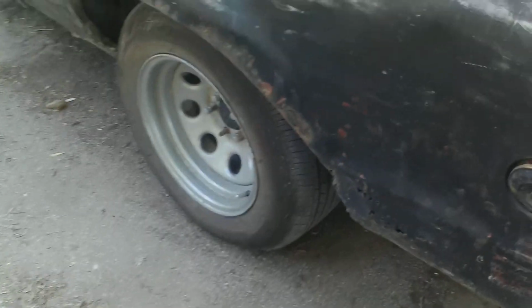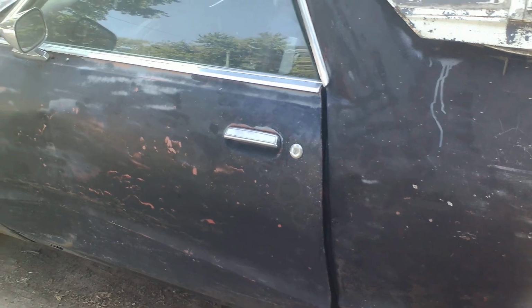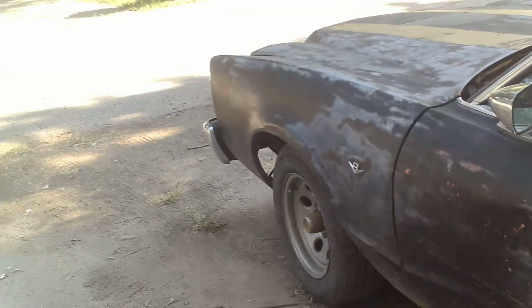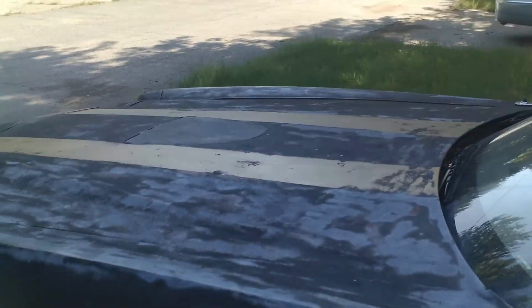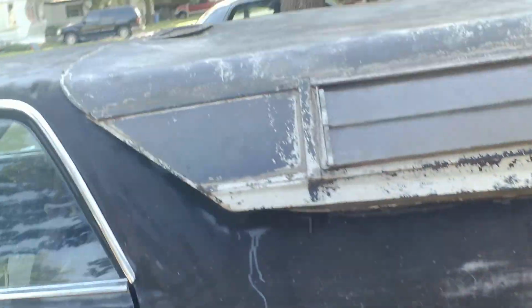It's an intact car. You can't smell it, obviously, it's a video, but my exhaust smells a lot cleaner and a lot less like raw gasoline, because I've tuned it up, and I actually learned how to tune a Holley 2-barrel H2 2300 carburetor for fuel and air. Basically, you tighten them all the way tight, then loosen it 1.5 turns on each side, tighten all the fuel air mixtures all the way tight, and then loosen them 1.5 turns. And then what you do is, I'll show you here right quick.